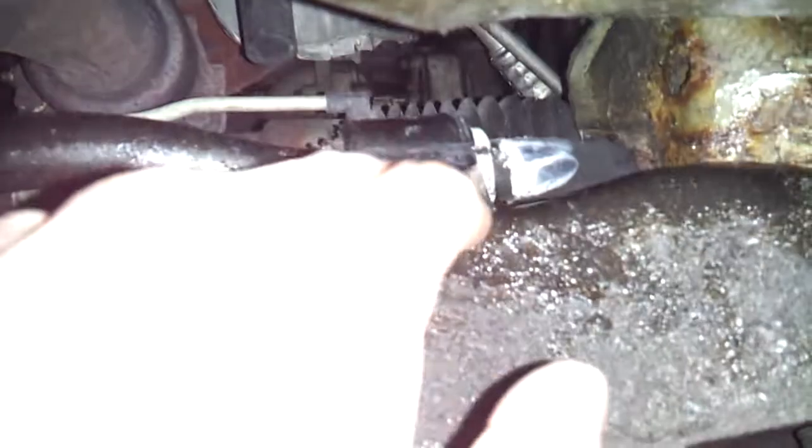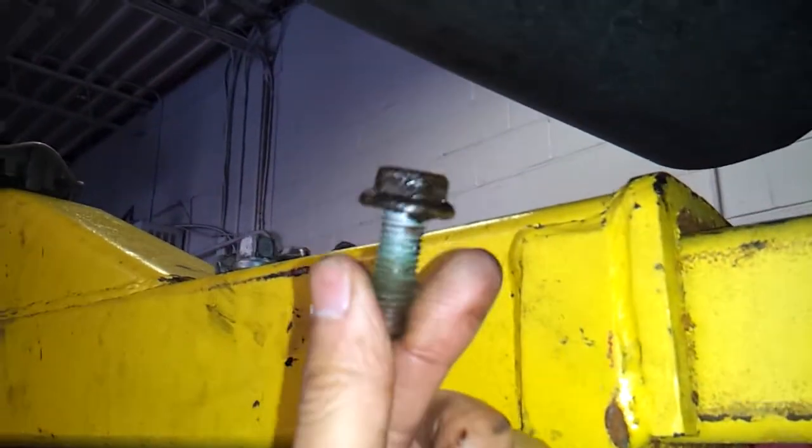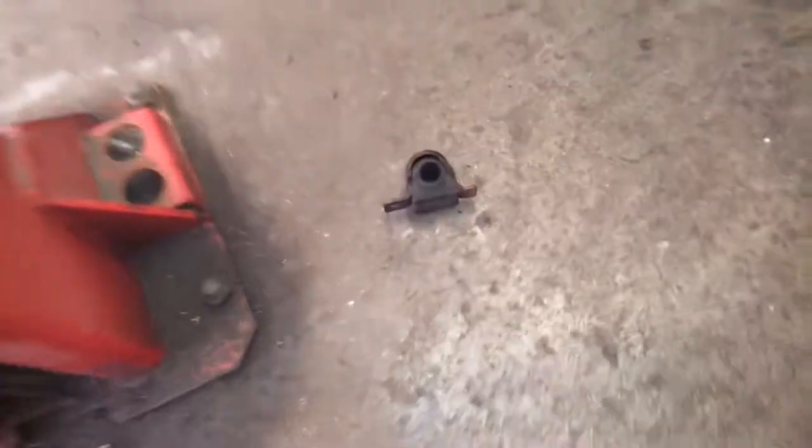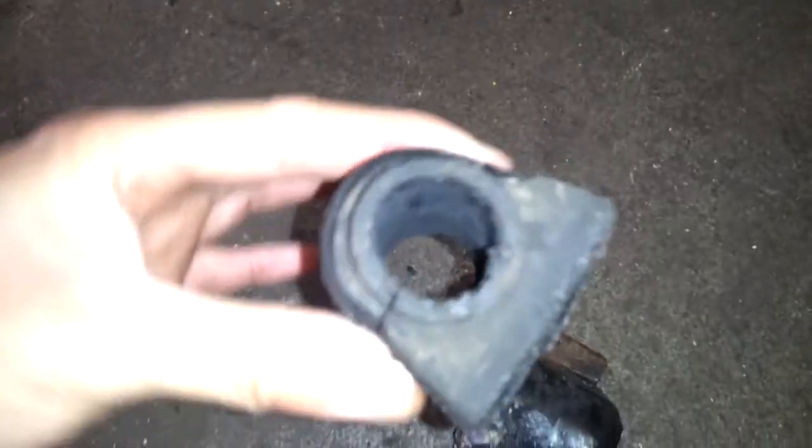Second thing that I did was I started going at the nut on the passenger side. It'll look like this. I guess it's a nut and stud, that's one piece, and then on this side it's just this 15 mil. They're both 15 mils. And after I removed that, I was able to get some slack in the brackets. This is the driver's side.